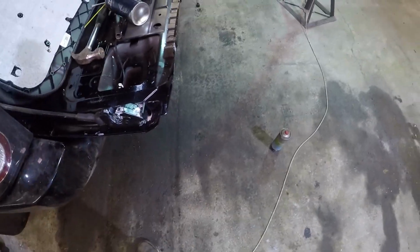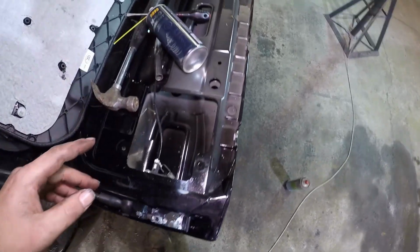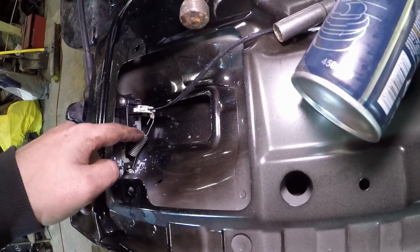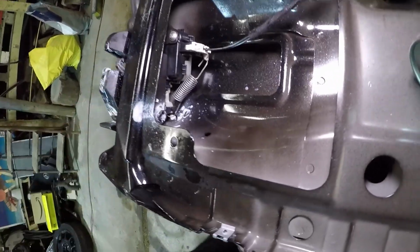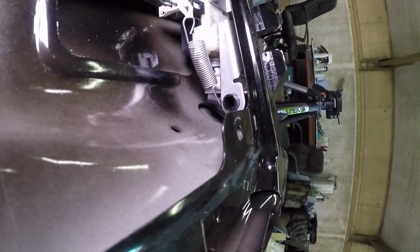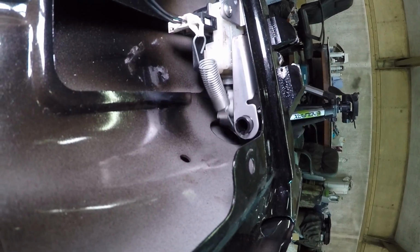But for me now, I thought I'd do a simple little repair, and I'd put a spring between the actuator arm inside, or the arm that gets pressed for the lock, and the actuator itself. So that way, they're going to work now, aren't they? They will automatically return, and what might happen as well with this is, because of the extra force that makes it return, it might actually free up the modules as they're used over time.